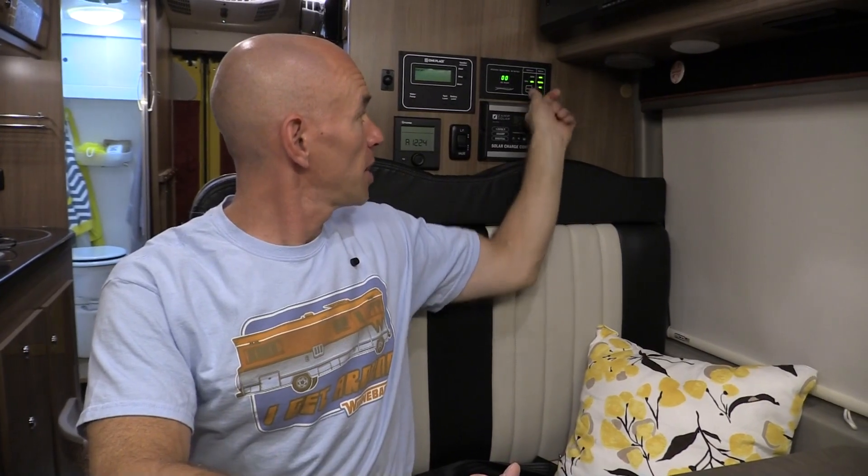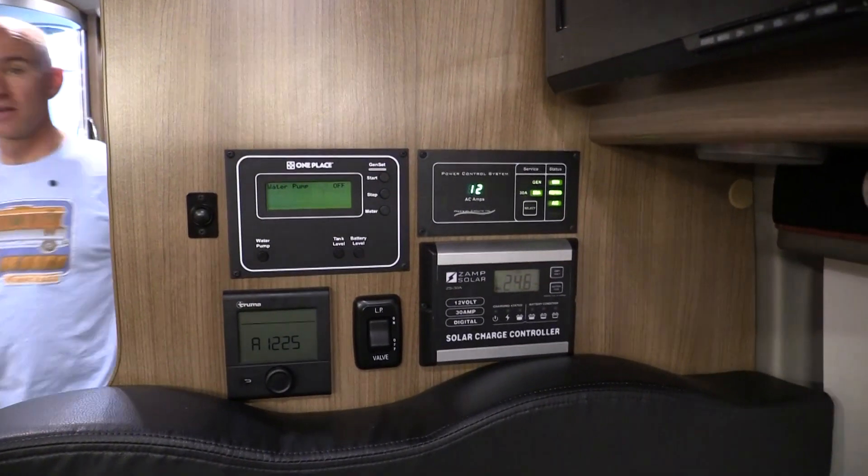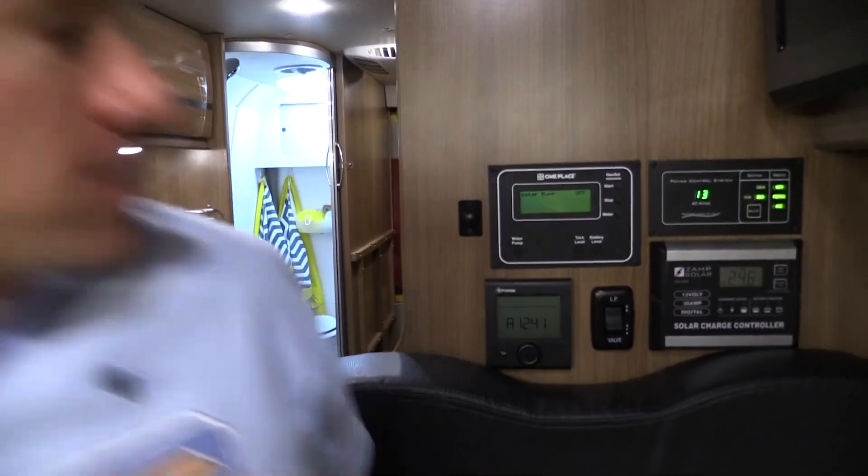So let's see it in action. First I'm going to hit the select button and make sure I tell it we've just got 20 amps to work with — that's what it's going to try to keep us under. Now I'm going to turn on the air conditioner. We should have seen a momentary spike up to like 14 or 16 amps, but now it's settled down running the air conditioner at 12 amps — pretty efficient. So let's throw a little bit more load at it. I'm going to turn on the electric element on the refrigerator. And there we go — one more amp, 13 amps total. The refrigerator doesn't draw very much.